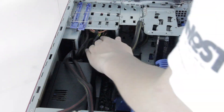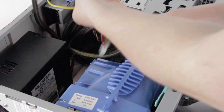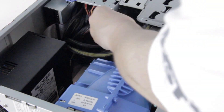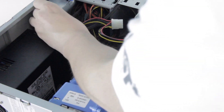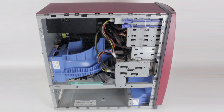If you need help choosing a power supply to use with this adapter in your Fuel, please visit the Nekochan thread linked in the description. Then run your hard drive cable from the power supply to your drives. For cleanness, I chose to route mine under the 8-pin motherboard connector, plugged into the drive, and then back up to the CD-ROM at the top, storing the slack in a spare hard drive bay. I also chose to plug the hard drive data connector back in, even though I won't be installing IRIX for a while. With the new parts installed, the Fuel is beginning to look a lot more finished, apart from the graphics of course.